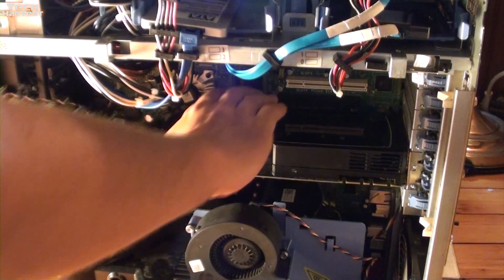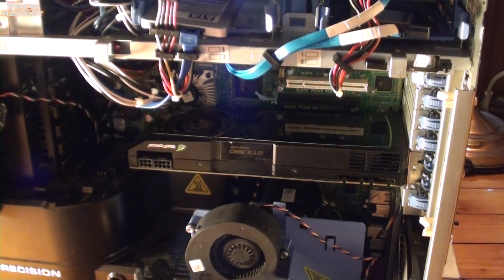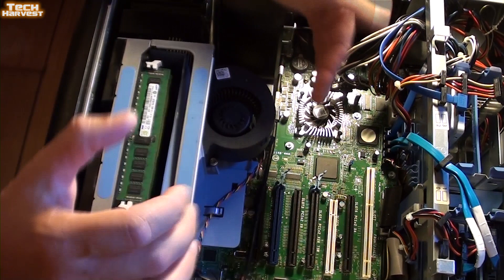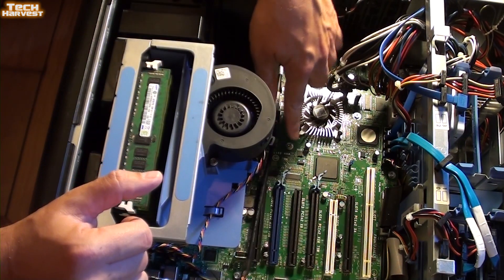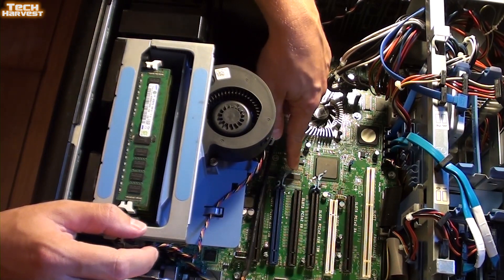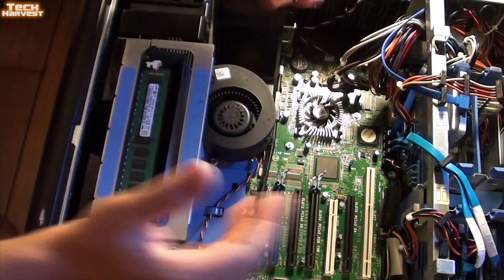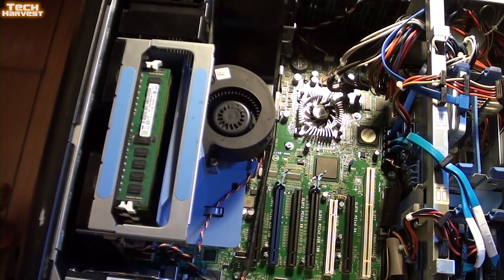There is a tab on the motherboard itself which I have to push down to release the card. I couldn't successfully film that because even though this is a full-size case, it was hard to film it and actually get my finger in to release it. The card was in this slot here but it was locked down with this tab. Once I had the card a little bit unseated, I reached in from the top — it was very close to the back — pushed the tab up, and the card came right out.